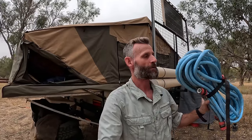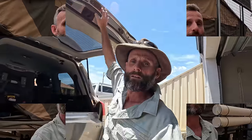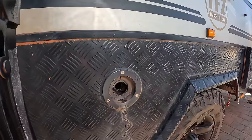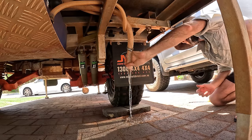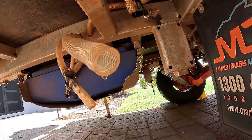It's an activated carbon filter with nano silver as well, so it's meant to remove the nasties — bacteria, viruses, all that sort of stuff. When it comes to filling your tanks, grab yourself a food-grade hose; I'll also use an inline filter on that — just a cheapie from BCF or Anaconda, around $40. That filter is probably not necessary if you're filling up from home, but when you're out on the road you just want to make sure. When we get back from a trip, I'll always empty the tanks, leave the bungs off and filler caps open to get positive airflow and let any extra moisture evaporate. I'll also disconnect all the water line connection points to allow them to dry out — you don't want algae building up in your water pipes or tanks. I also drain the hot water boiler.